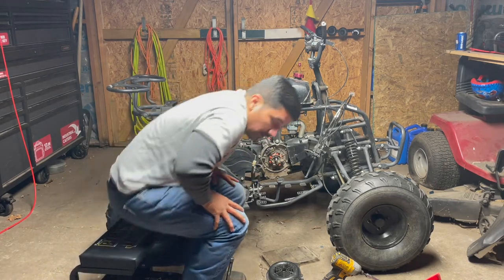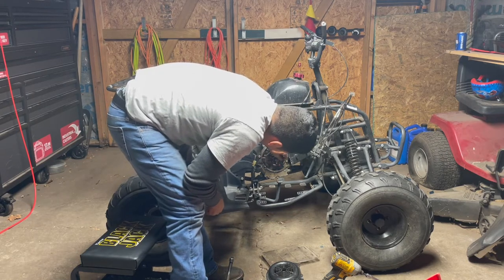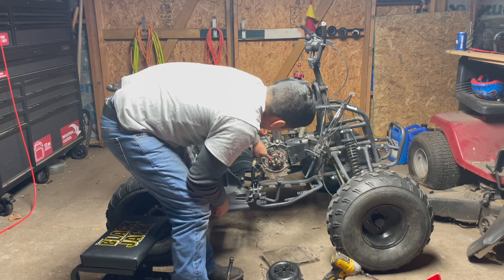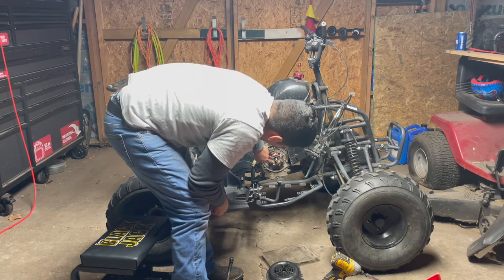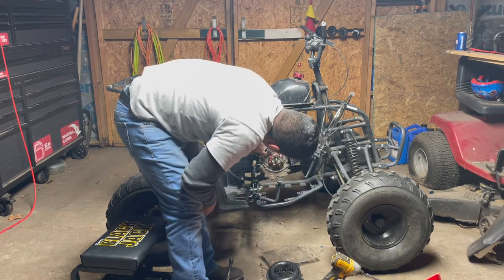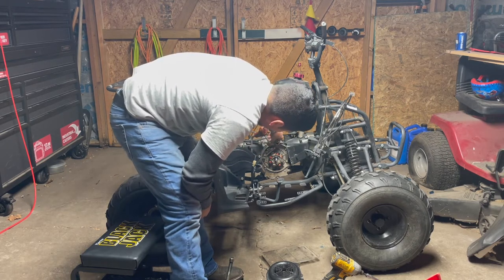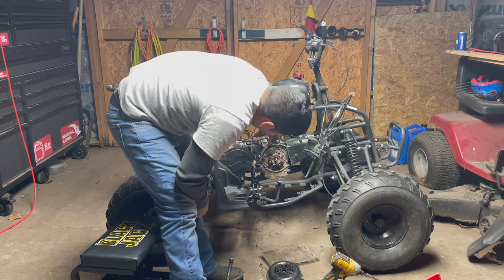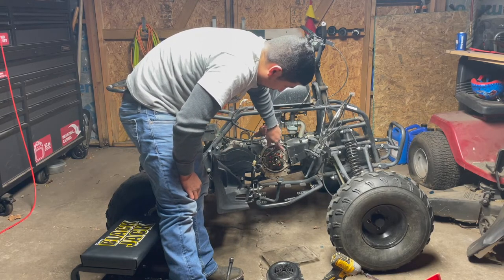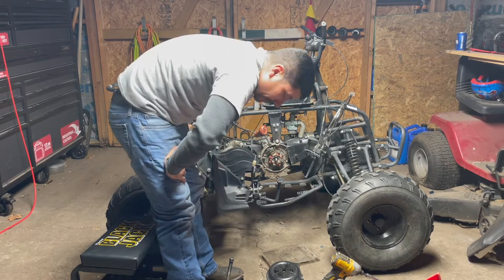So this is your coil, and it's actually got cobwebs on it — like spiders living in there. You're going to have two 8mm bolts there, two 8mm bolts on that bracket. That bracket is to hold this wire down, and then two 8mm bolts here. It's literally just going to pop out. Make sure you put that grommet back — that's to keep any dust and everything out of your stator.